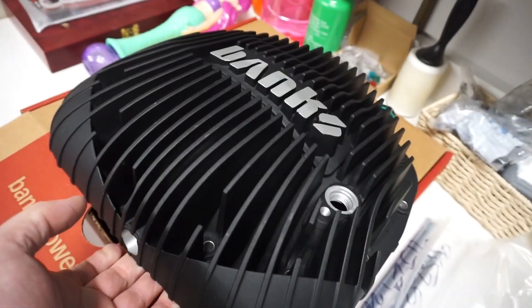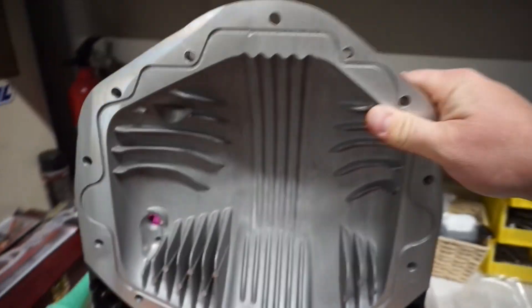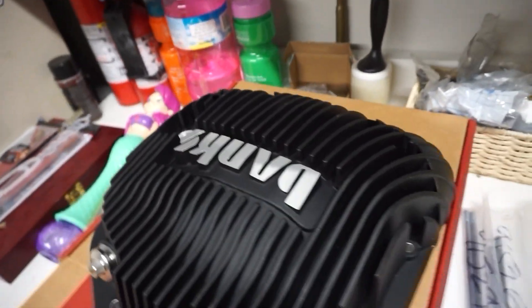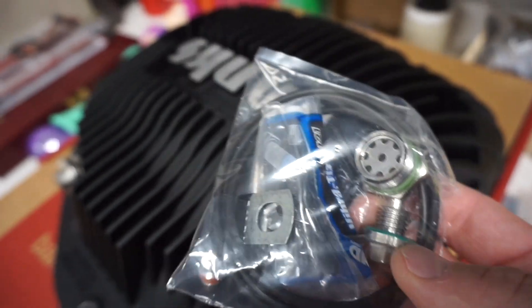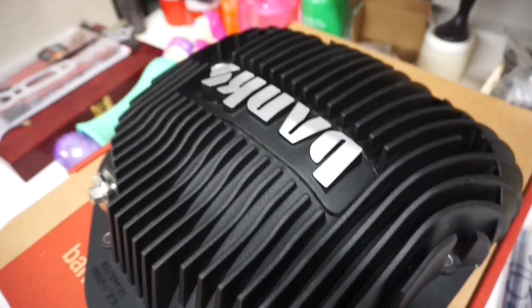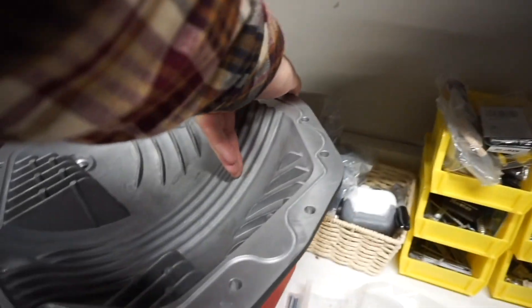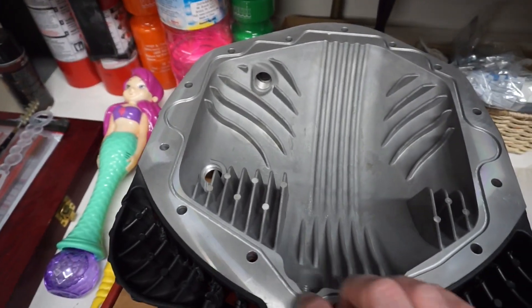As you guys can see on these Ram air scoops right here, the air actually comes through here because this is sitting like this in the vehicle, so the air comes through the scoops, routes it up the back, and gets better airflow up these ribs and onto your diff cover to cool it off. You have a magnetic fill plug, a magnetic drain plug, and a sight glass that'll tell you when it's full — sometimes halfway, sometimes completely full, dependent on your truck. And there's an O-ring seal, so no messy RTV sealants and no possibility of a leak. That is one thing I absolutely love about this cover. I hate dealing with gaskets and RTV — I like a one-stop shop.